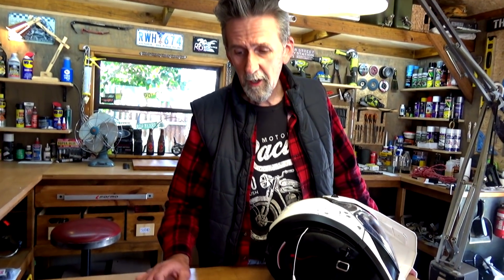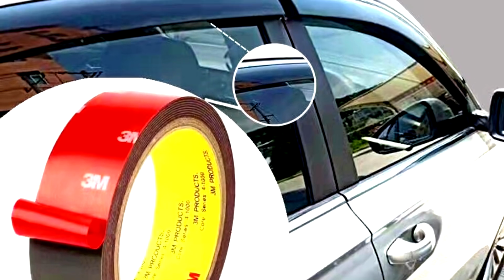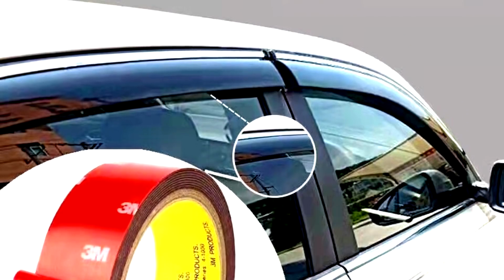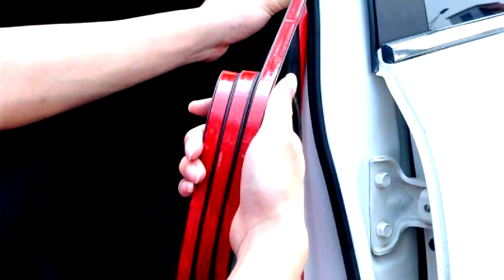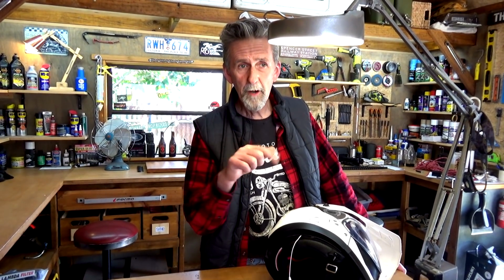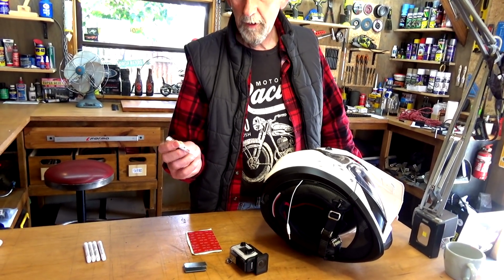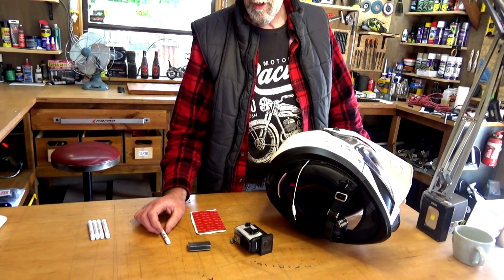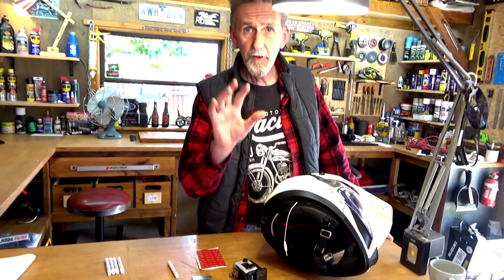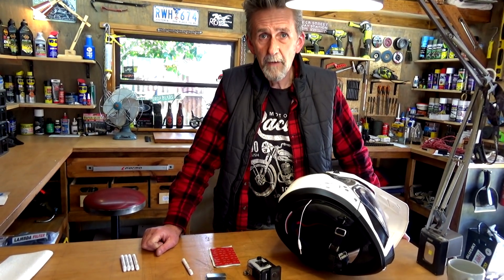They're used heavily in the automotive industry for weather strips on cars. You know, the little weather trim on the outside of the car near a window. They're not clamped on anymore. They're stuck to the outside trim. So in the automotive industry, in panel beaters and so forth, that's the way they're attached. Where you clean the surface, you apply the 3M Primer 94 onto the area which is going to stick. You stick it on, and within 72 hours, that weather strip will never come off.